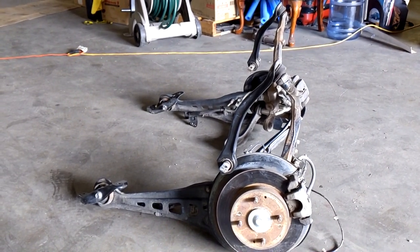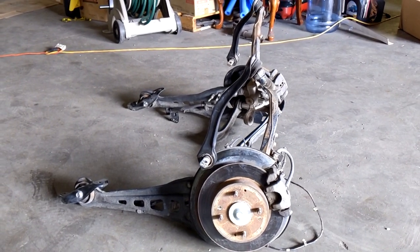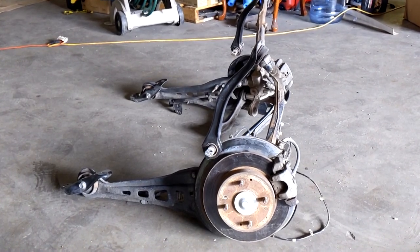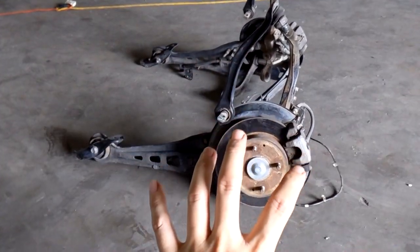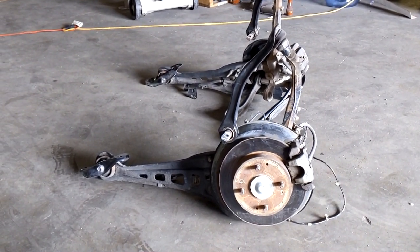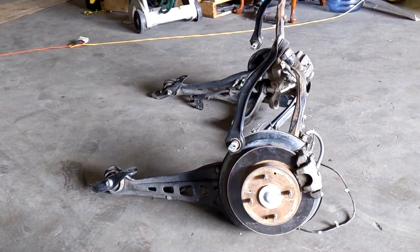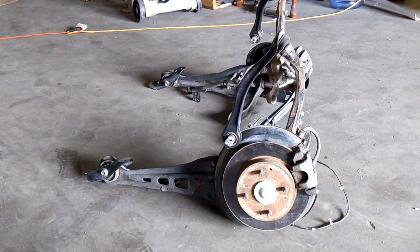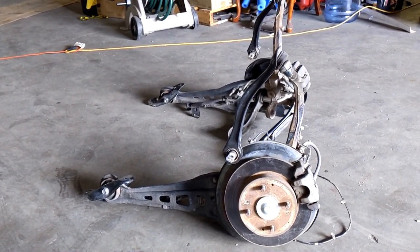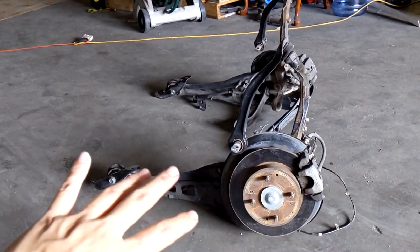Most of the braking is done on the front wheels, but what they don't take into account is how hot the rear drums can get, because it's basically just an enclosed case, and that can lead to much quicker brake fade and brake wear that you just really don't want on the track, especially on hard braking tracks. At MSR out here in Houston, I probably don't have to worry about it too much, but those Cali tracks are high speeds, pretty hard braking. So I just went ahead and got this for like $200 for both, everything I need.